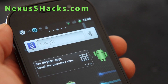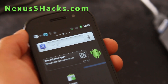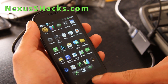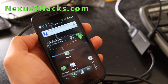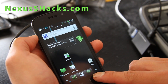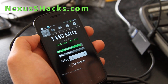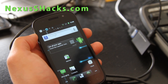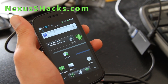I'm going to stick with this setup. The reason I'm not getting any signal is I don't get any T-Mobile signal out here in my basement. Anyway, that's my current setup with CM7 and the Trinity 1.44 GHz kernel. You can try the 1.55 GHz — if that doesn't work, just flash 1.44 GHz and you should be good to go. Don't forget to set it back to lazy, on-demand, or power save so it's not running overclocked all the time. Thanks y'all and see y'all later.